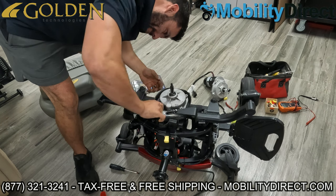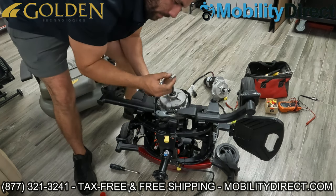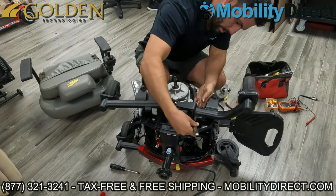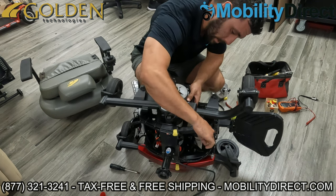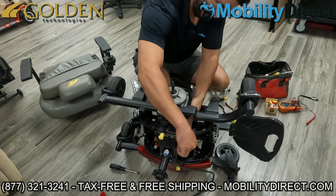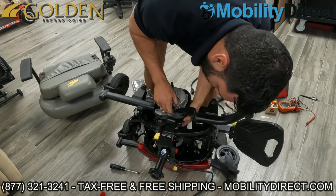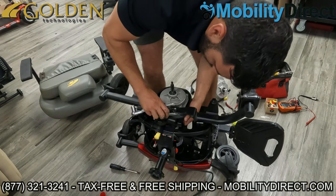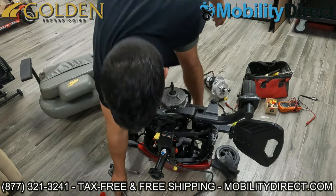You'll also notice that there is a tubed washer underneath that silver plate, which I just took out. You don't want to lose that — the bolt's going to slide through there, and that washer is definitely something you need to have, so don't lose that washer. Now we're moving to the other bolt that works with the suspension assembly, and it just takes a socket wrench. You go from the inside part. I have the wrench underneath the assembly while it's tilted on its side, and you just have to use that wrench to remove that nut.